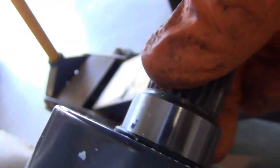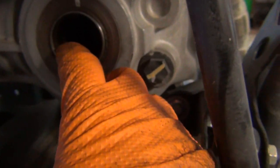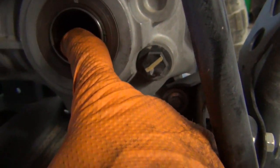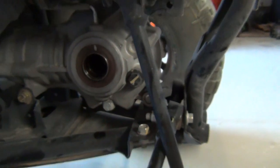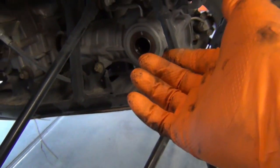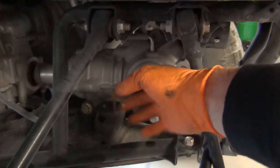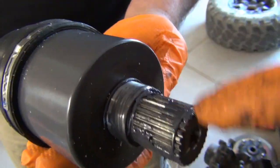If you grease this up and then grease where the seal is, especially on this front shoulder, then you won't tear the seal as it goes in. There's just a little rubber seal there. This one's like clear up in there. Yeah, you don't want to mess that up. That looks like it'd be expensive and hard to replace. There's seals that are like $5-$10 you're used to, and there's these $30-$50 seals. That's what this looks like. This is way too much, by the way.